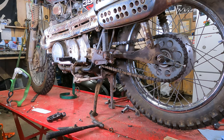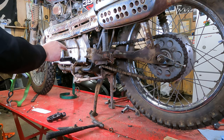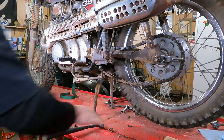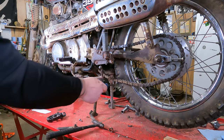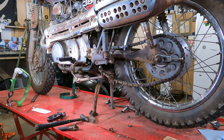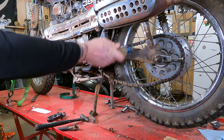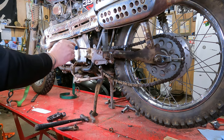When you're setting your chain tension, the tension you're setting is really from the rear sprocket to the front sprocket underneath the cover. The further back the wheel is, the tighter the chain; move the wheel forward and the chain goes slack. The technical spec is the chain slack should be 2% of the center-to-center distance from the front sprocket to the rear sprocket. However, your swing arm pivots — and as it pivots down or way up, your chain is going to get looser because the distance between sprockets is getting shorter.